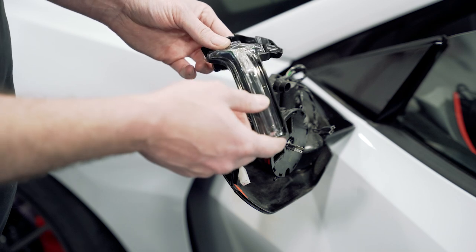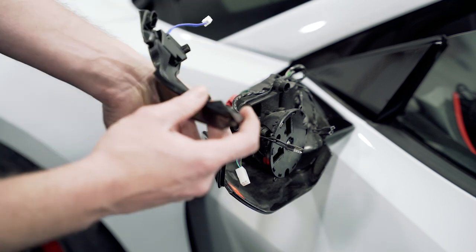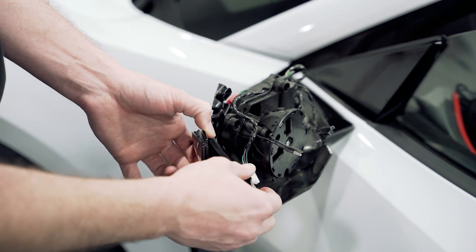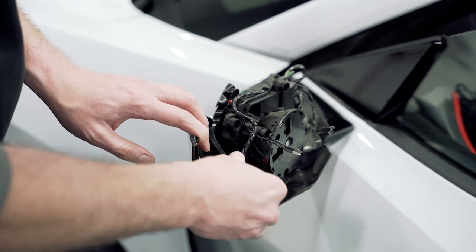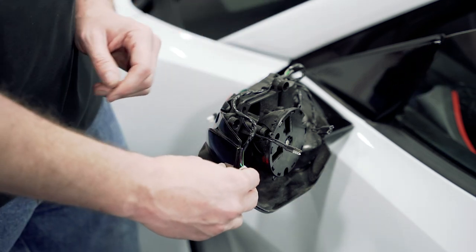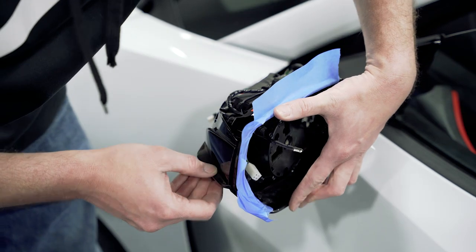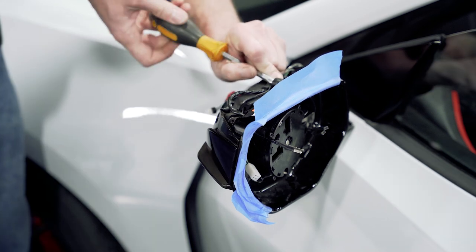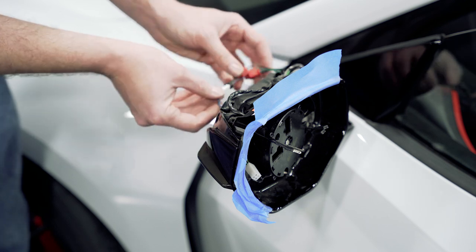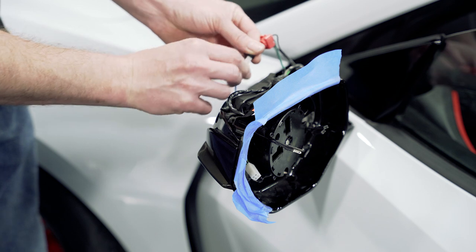Now that we've got it out, grab the new one and get it installed. We've got our new smoked sequential side marker light — reinstall it in roughly the reverse order. Pull the plastic out and wiggle it down, keeping track of your wiring so it stays out and forward toward the front of the car. Put the trim bezel piece on the front and the screw back in, reinstall the three screws on the back, and plug in the electrical connector. While installing the front trim piece, make sure all your wire connectors pass through. Always double check that the light works before you get everything put back together, because you can plug this in either direction but it will only work plugged in one way.